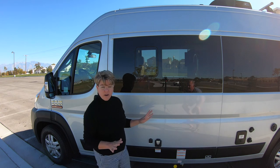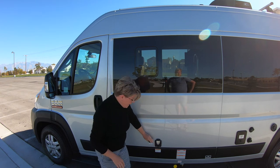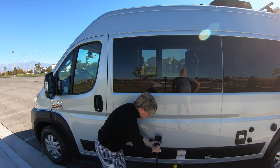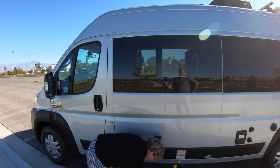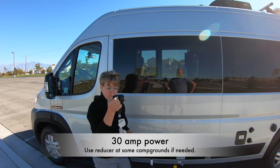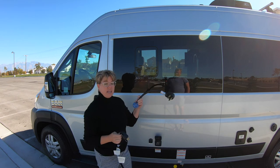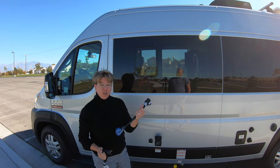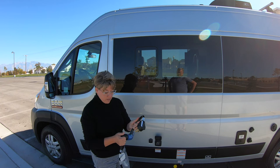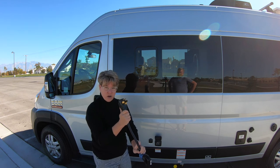If you are going to an RV park and you want to hook it up, you can hook up cable right here if they've got that available. Right here is going to be your shore power — you can plug this in. This has to be twisted on. When you take it over to plug into the RV park, you may not need both pieces, but you do have to make sure it's 30 amp only. This van only takes 30 amps. If the RV park has higher than 30 amps, you'll need the reducer and it will reduce it from 50 to 30. You just connect it like this, push it together, and this piece goes in to the RV park.